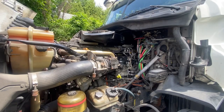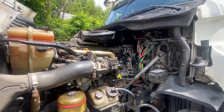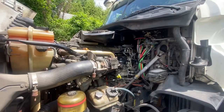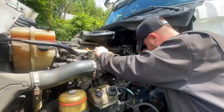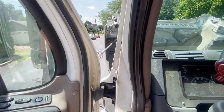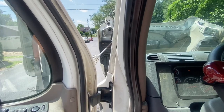We put 47 quarts of oil in and now we just gotta wipe everything down. Now we're going to prime the fuel system because we created an air bubble. There's a plunger right here next to these two fuel filters — you gotta unscrew it, that's going to pop up. Now you just gotta start pumping until you start feeling a little resistance like fuel being pumped in there. We gave it a million-plus pumps — let's try to start it up. We've got to keep priming to get her to suck some fuel up.